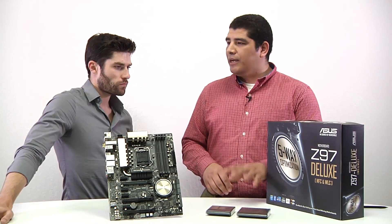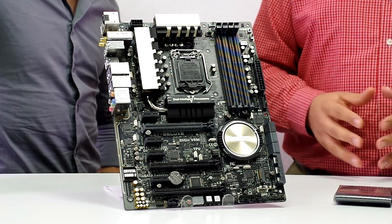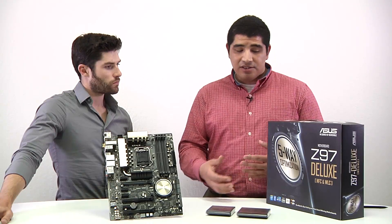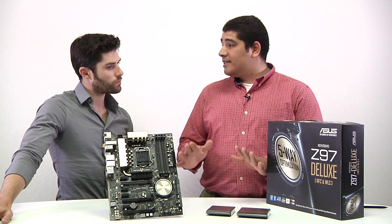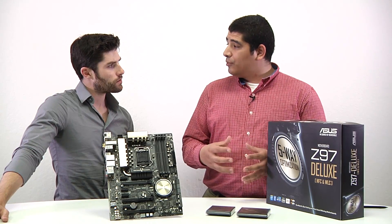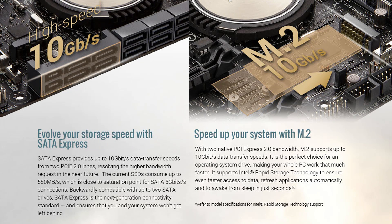If we evaluate where 8 series was to 9 series, there's not a huge amount of difference between the two on paper — they're going to look pretty similar. It's the same socket, the same memory support, the same number of PCI Express lanes, so multiple GPU and expansion capabilities are pretty much exactly the same. The biggest points of differential are going to be official support for SATA Express and M.2 specifications, which are faster storage connections than your current SATA spec. But it's not 100% built into the spec — it's open to the manufacturer to implement.